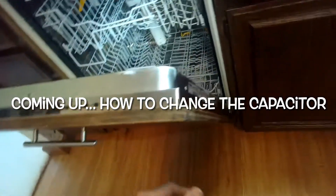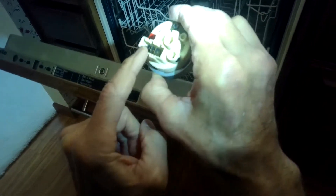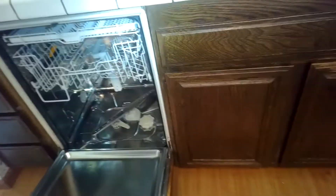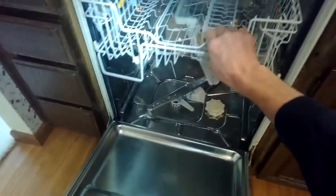The capacitor is probably what needs to be replaced — the capacitor for the circulation pump. We're going to replace both today just to make sure, and we'll test the heater pressure switch values compared to the new one. To do all that, we'll take out the bottom rack, the middle rack, and remove some water from the sump.